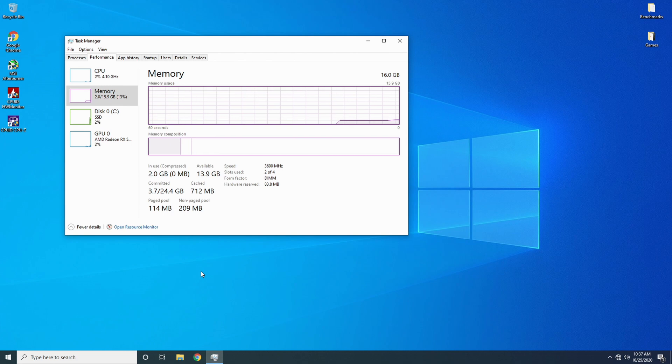Since that's how I showed you how to turn on DOCP on this motherboard and how to manually overclock it if DOCP isn't working — that's pretty well the way you overclock your RAM on this board. I showed you the automatic overclock with DOCP, then the manual overclocking as a fallback. In the manual side, I put in the same exact settings DOCP had set. That's a good starting point — if DOCP isn't compatible with your RAM and motherboard, manually entering those numbers often works. If it still doesn't work, you may have to loosen up your timings a little bit or turn down your speeds slightly, but it gives you a good starting point for manual overclocking.